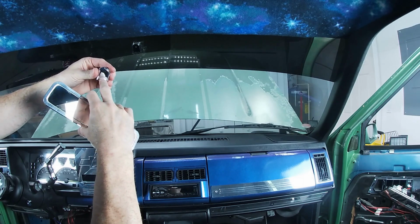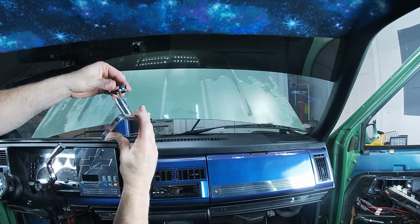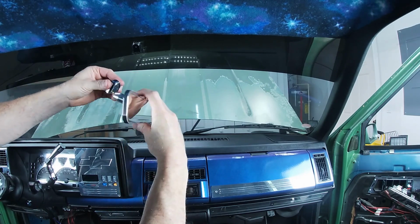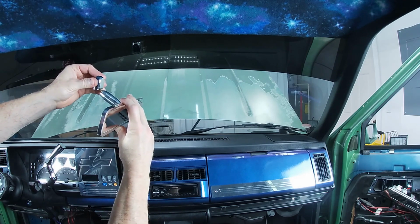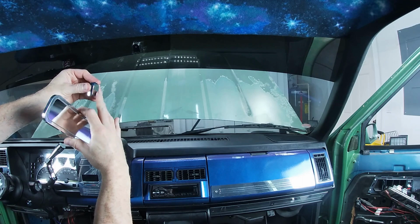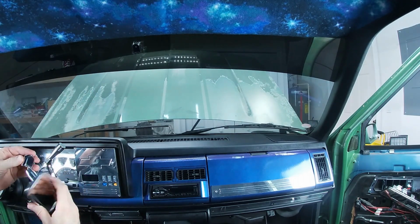We're gonna have to drill a hole into here and tap it with the same threads this uses so we can mount this here like this instead of on the bottom. That'll fix the problem because that'll give it enough angle. As you can see here, this is too low at its highest. If I put it here, that's exactly where we need to be. So I'll have to save that for another video. Always something.